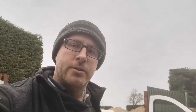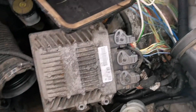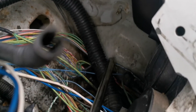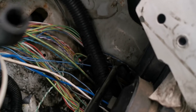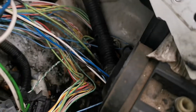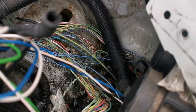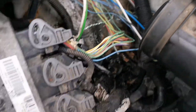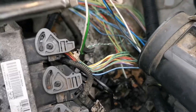We've also checked all the wiring through here. You've got your signal wires - the blue and white twisted ones coming up from the pump - and a single thin blue one which is your ignition live. The CAN wires come up to a T-junction here, then go to the green and white twist into the ECU, and from that T they go down to the ABS pump just underneath the ECU. We did a resistance and continuity test and that all came back fine.